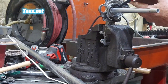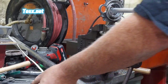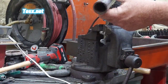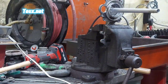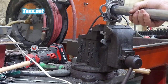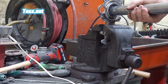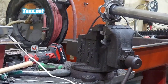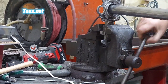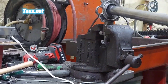If you use a seal puller, that seal actually pulls out rather easy. You just have to have it in a good vise so you can get a little pressure on it. Then there is a snap ring pliers that comes out, and this is the new idea on how to take care of the existing tube — before, I just cut it off and drilled it out. If you put a little pressure up and down with a piece of pipe, you will see when it's out that it has four holes cut in it, so it has a breaking or cracking point. It actually comes out rather easy with a couple of sharp blows from the pipe.